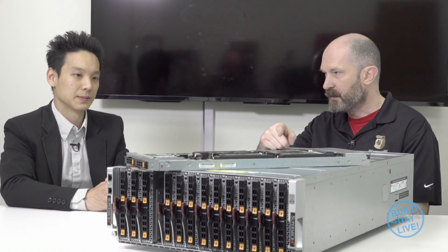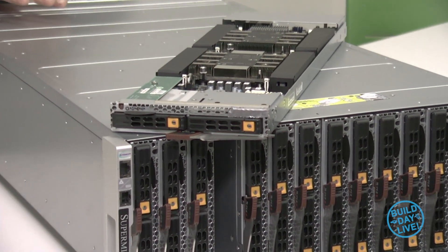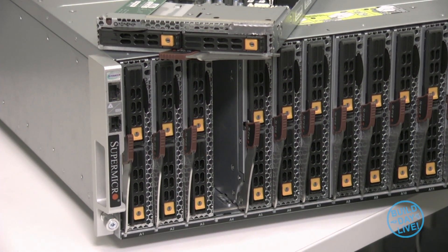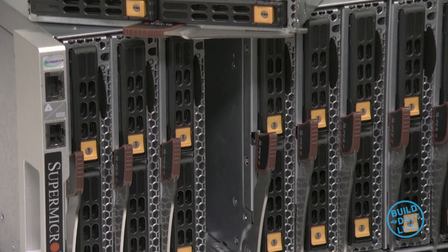It has the highest power Xeon Scalable CPU, so it's dual socket. It's full power CPUs — no compromises. You can have like 48 cores in each of these. You can populate two CPUs and also 16-channel memory to give you enough memory for in-memory computing.